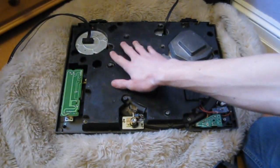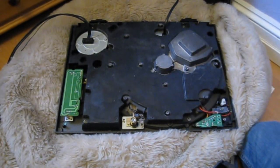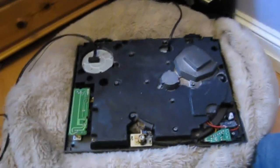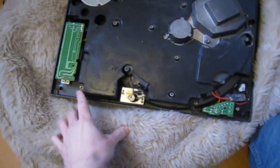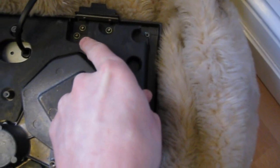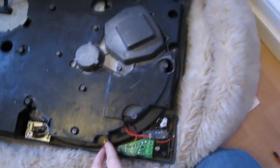Next thing you need to do is remove this plastic piece off the bottom — it's very brittle, so you've got to be very careful. Let me just show you where the screws are. Looking at it from above: you've got a screw there, a screw there, a screw there, a screw there — not those two, they hold the hinges on — a screw there, a screw there, and one there. If you take out all of those screws, you'll be able to get this plastic piece off. Again, there's another video linked in the description with more detail on getting these screws out.